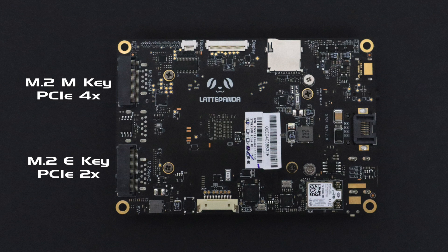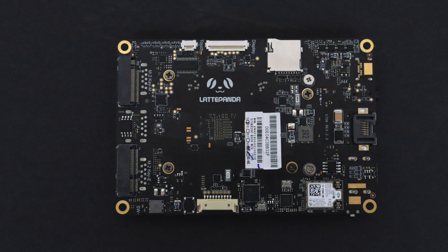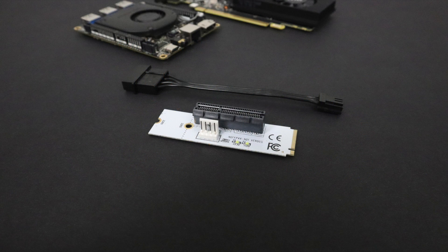As you can see, this board supports two M.2 slots. We have an M.2 M key that supports PCIe 4X and an M.2 E key which only supports 2X. So I'm going to go with the higher performance M.2 M key that supports PCIe 4X. To do that, I'm adding one of these small adapters — an M.2 M key to PCIe 4X. I picked up two of these for eight bucks on Amazon; I'll leave a link in the description.